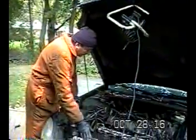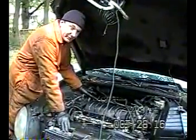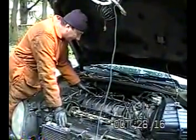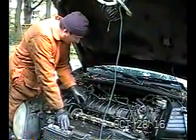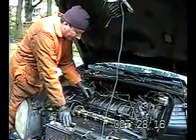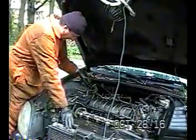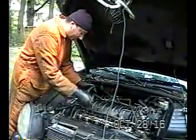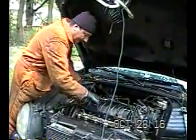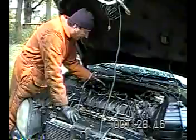Okay, we took the rear valve cover off, and we absolutely had to lower the engine cradle in order to give us the room to get that off. It's not a problem. One thing I wanted to mention is we had to unbolt this coolant hose, which bolts onto the intake manifold, but this is the hose that goes into the reservoir. We had to move this out of the way because it was in the way. You could do that. There's just two little clips here. You screw them off. Anyway, I had to do that. Maybe you won't have to. But this here has been a real irritant to me, and I want to get rid of it.